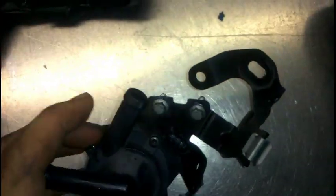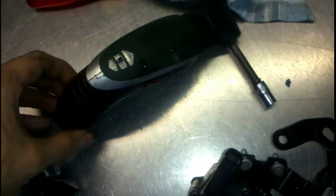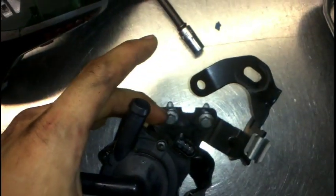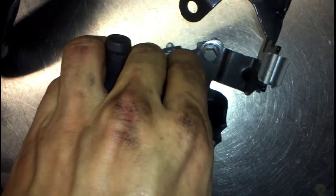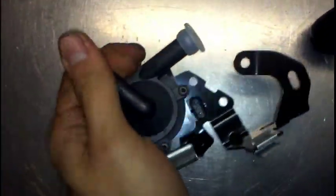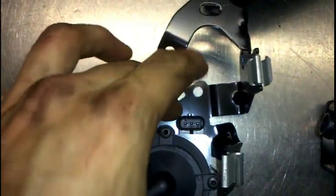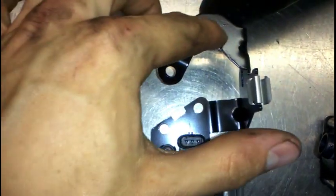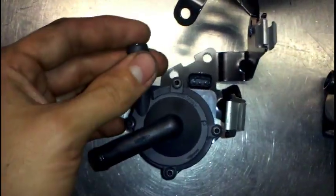We've got the old pump out. That's the new pump we're going to put in. Those are the two 8mm bolts across here. Turns out my trusty Bosch IXO was unsuccessful getting the left-hand side out — right-hand side was no worries, just crack that off and drill it out. But this one is a fingertips job. You've got to get up there and just get your fingertips onto it and give it a bit of that. We'll put the new one in — take these caps off obviously. So just again, that's oxygen sensor wiring, two 8mm bolts, a plug, a little raw-plug clip, and two hoses.